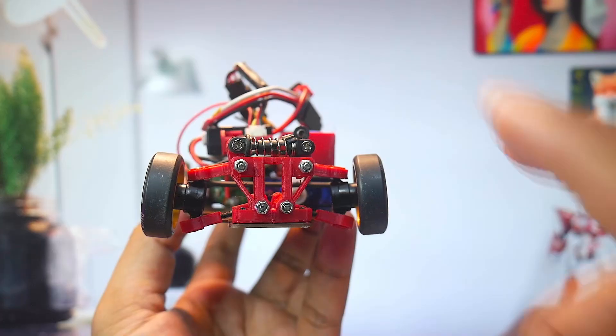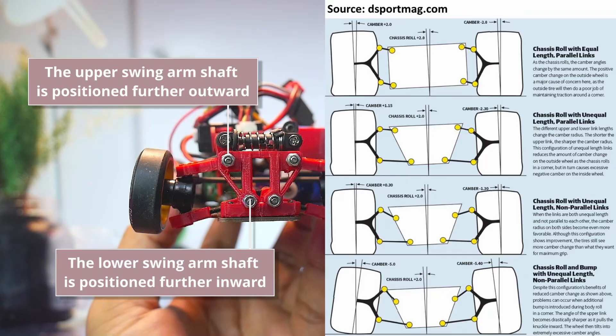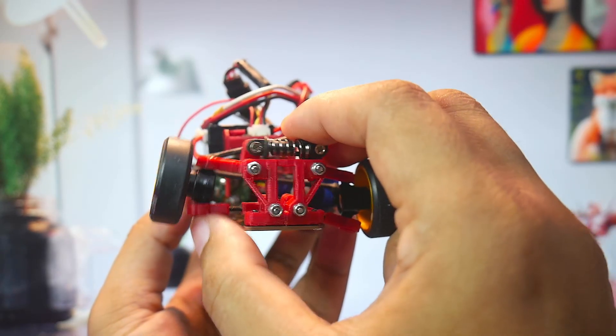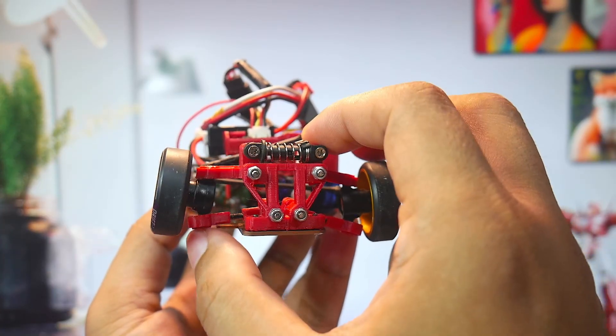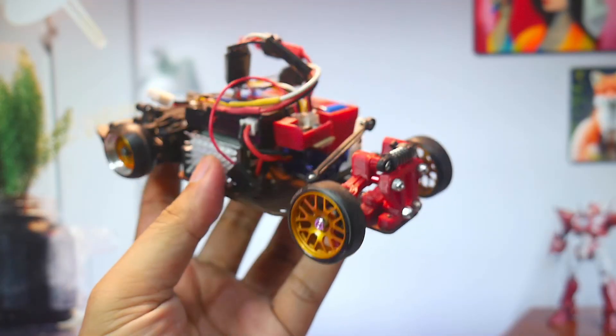I designed this bulkhead based on proper automotive construction techniques, specifically using an unequal length setup where the lower swing arm pivot is positioned further inward than the upper one. The purpose of this is to ensure that the front wheel camber, as the suspension moves up and down, always provides maximum traction.